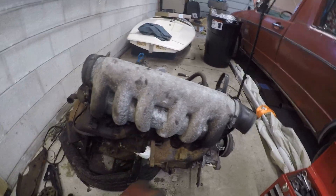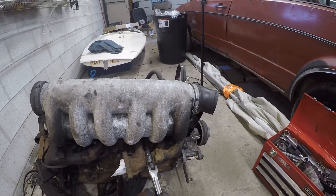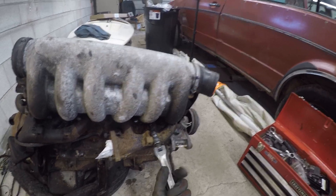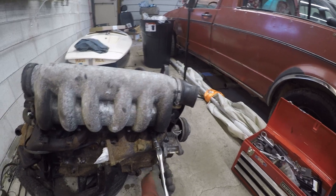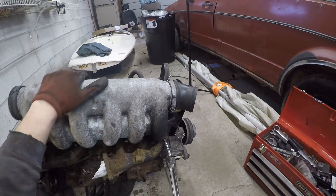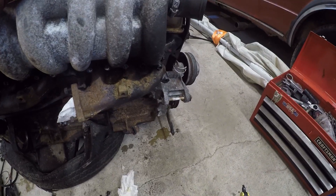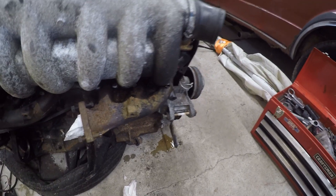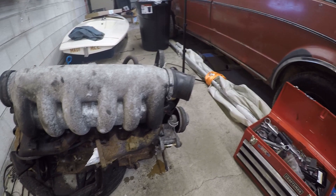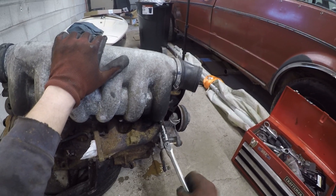I got a surprise in cylinder number one — just wait. There's water in cylinder one, which is not a good sign. That's probably why our engine is nice and stuck. I gave it a smell test — just to be sure it's not coolant — and it is water. Water in your engine will definitely lead to it being stuck; you'll get a buildup of rust and your engine will freeze.